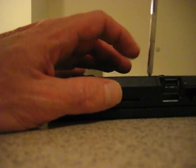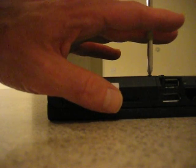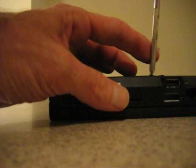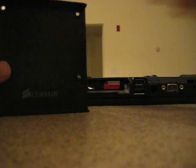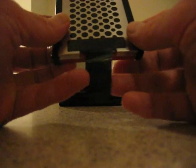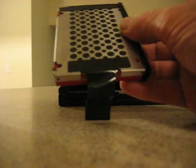So here's the hard drive cover. I'm going to take that off and explain what happened. I found out this week that the strap is actually a caddy. I didn't know that because the user guide that comes with this computer doesn't mention anything about that, so it's not completely my fault. This is my first laptop, and this is the caddy I'm used to seeing. The user guide only mentions removing the plastic side bumpers from the old hard drive and putting them on the new one — it never mentions removing the hard drive from the caddy. But as you can see, I took the DIY tape strap I built and removed the caddy from the old hard drive.